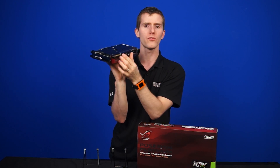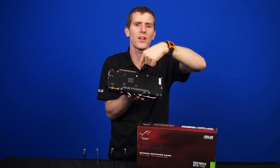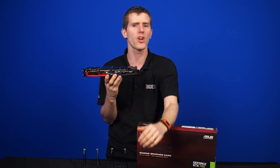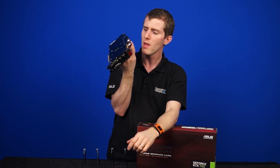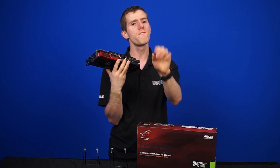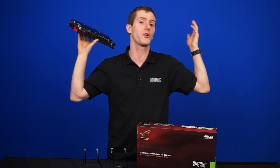Underneath that is where the real magic happens. These two outlets use standard G1/4 threads, which means you can put whatever fittings you want on them. They are connected to a U-shaped water channel that goes through a custom vapor chamber, which in turn makes direct contact with the GPU. These fittings allow you to simply screw in your desired barbs and it'll work perfectly with the rest of your liquid cooling loop. It's probably a little on the restrictive side, but we'll find out when we throw it on the bench.